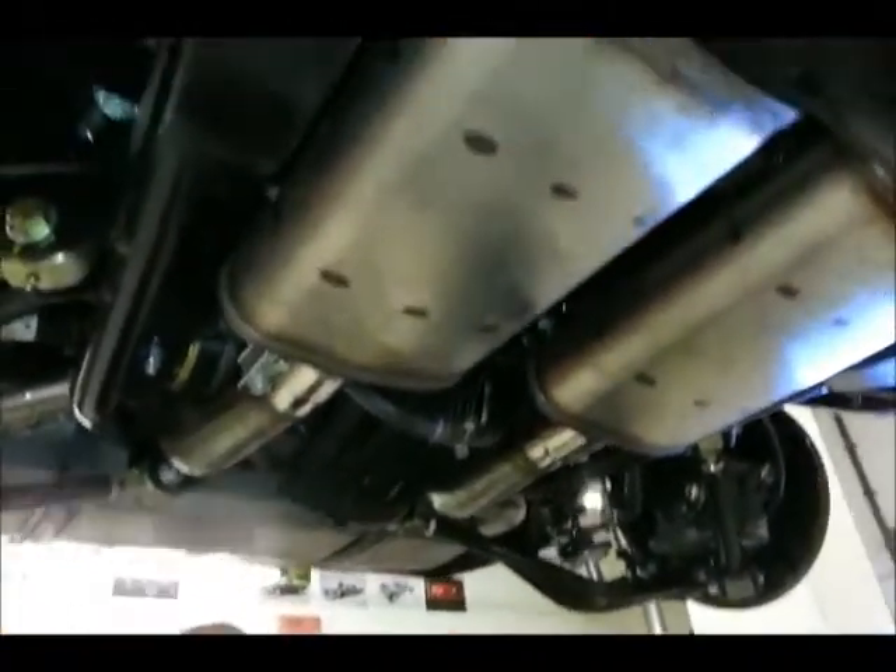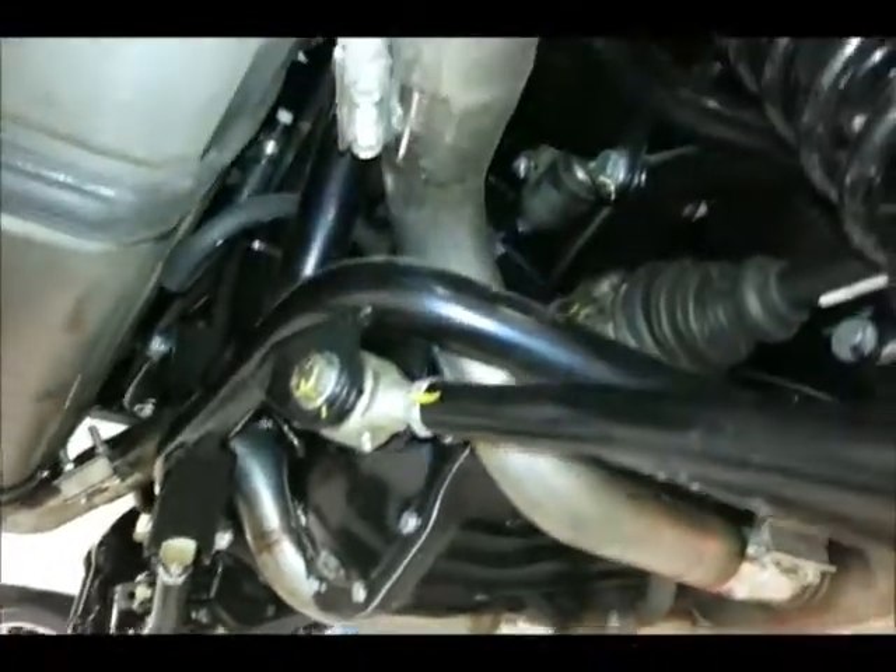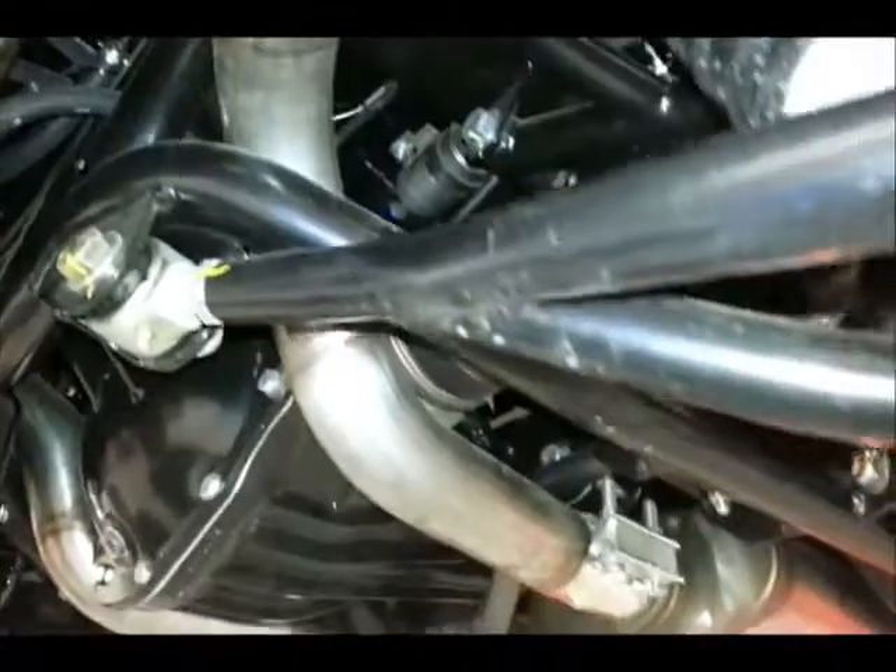This is kind of a self-contained cradle, but it doesn't necessarily bolt right into a car — there is some modification required. There needs to be some brackets on the frame rails to bolt up this cradle. Most cars, because of its compact design, you would not have to cut the trunk. But these are not factory frame rails on this car any longer.